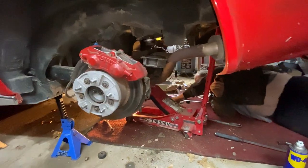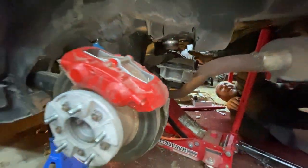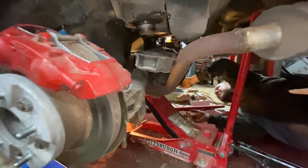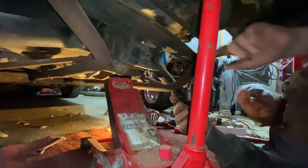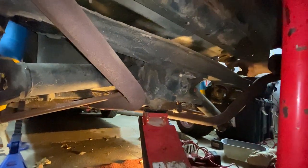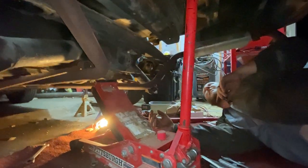You got cotter pins? That's what YouTube's for, isn't it — to see what it looks like before you take it apart. Well, I don't like to claim that I use YouTube all the time, but the best of us do. So for you guys to know, on a 77 Vette, you've got these little body mounts right here. The gentleman on YouTube showed us: pickle fork on the backside of the bushing, drive it through, wiggle wiggle, shoot a little spray in there, wiggle wiggle, boom — they pop out. I ain't gonna lie, I fought it a little bit, and then I got on the boob tube.